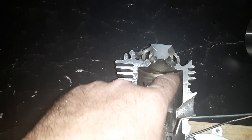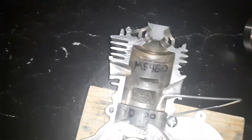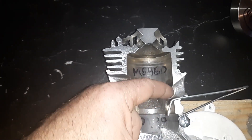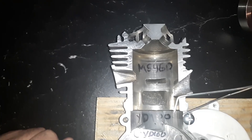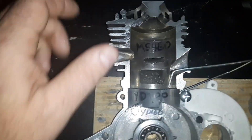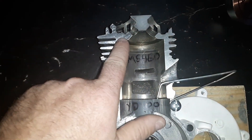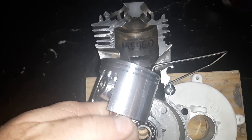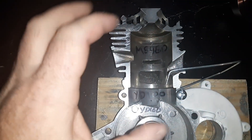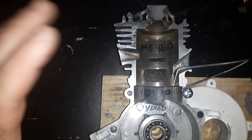Using a pop-up piston will fill this gap and that's how you can change your squish value. If you change it any other way, the piston is going to either catch on this port or go down below this one and you'll blow your bearings and destroy the engine. Also, they do make pistons with a longer skirt so you can do this — that's how a lot of saw builders do it for competition saws, decking the case and all that.